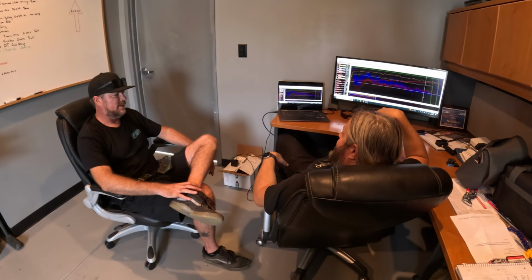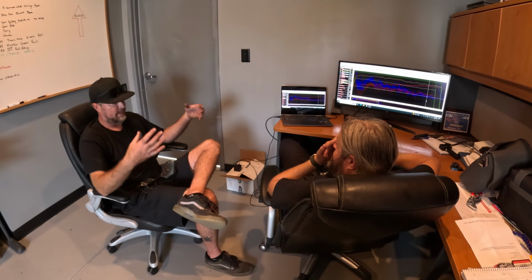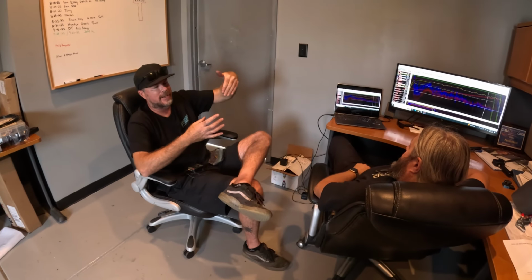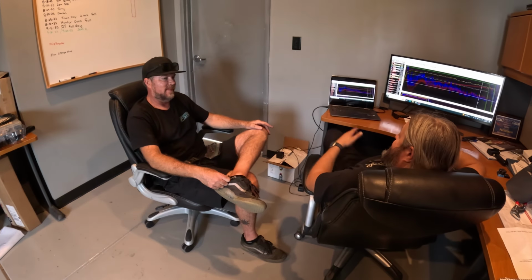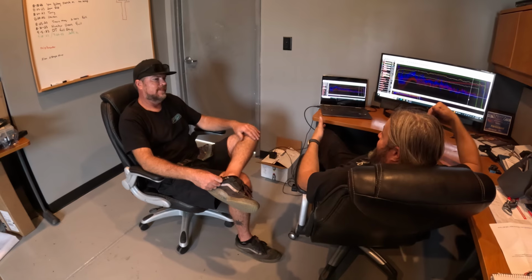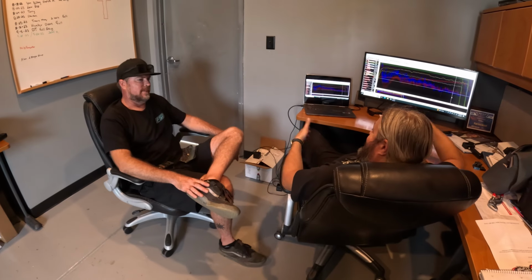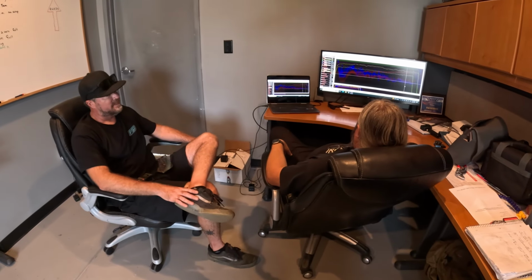Yeah, because a Hemi, as opposed to a wedge head, the intake port and the exhaust port are directly in line, so the air can come in and go right back out. It can literally blow straight out. It's a double-edged sword. It's part of why a Hemi is badass. That's why they work so good with blowers. But it's also why they have other issues.